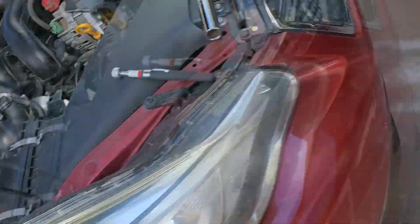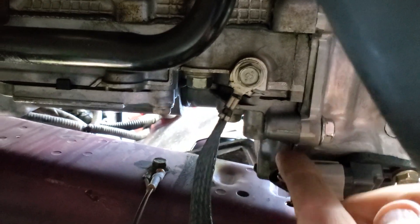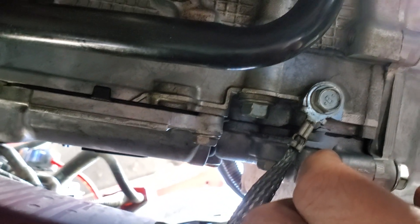Underneath, I do have a little bit of a leak. After I drove it around a little bit, let me get underneath here. I know you really can't see it because the oil is clean, but it's just right up in here. I don't know if you can see it on my finger, but it's just a little oily right there. What I think I'm going to try to do is just go along here and tighten up this bolt right here, see if it has any little play — just give it one little snug, and maybe this one. Because all it is, it's just barely dripping right there. I don't want to pay that amount for a tiny little bit of oil loss.